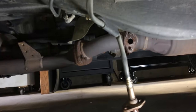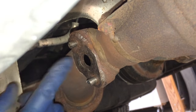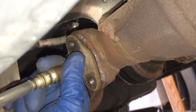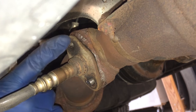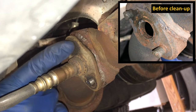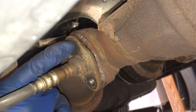When I went to pick up the vehicle, I decided to have a quick look under to see if I could see anything obvious, and there was something real obvious. You're looking at the opening for the number two, the secondary Oxygen Sensor, the post-cat Oxygen Sensor — and this ought to be in there. There's a failure of two nuts here. I did clean this up; I wasn't going to make a video, then I decided this might become more common as rust is growing on these older cars.